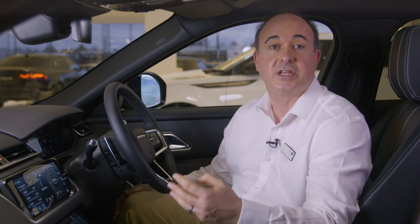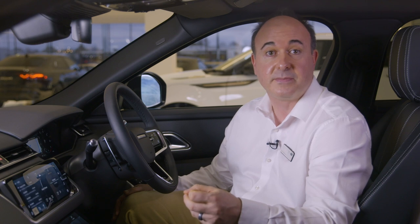PIVI Pro learns your regular journeys. On startup the navigation tile displays up to three predicted destinations, each with an estimated time of arrival taking into account your usual driving style and current traffic. If you sometimes drive to the same destination using different routes it will identify the fastest based on current traffic. For frequently used routes the system displays the route but doesn't provide turn-by-turn voice instructions; however, if you enable the smart voice guidance feature in navigation settings, the system will announce any issues on your commute and provide alternative route guidance, automatically enabling voice guidance on unfamiliar roads and muting it on familiar ones. An additional setting labelled Auto Start Commutes allows automatic initiation of your most regular journeys, so you can get traffic updates without pressing any buttons beyond starting the car.